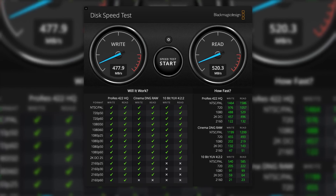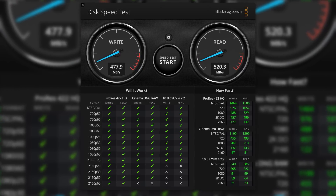Now let's talk about USB — there's a problem with USB too. I was using my Samsung T5 drive; I have quite a collection of these and I like them. I thought it was a bit slow when copying files from the M1 Mini, so I ran Blackmagic Disk Speed Test and was very surprised at the result — it was slower than the USB 3 performance on my old 2013 Mac Pro. So I tested it on the M1 Mini, the M1 MacBook Air, and also my Intel MacBook Pro 13-inch. On the Intel I got 478 megabytes per second write performance and 520 megabytes per second read performance.